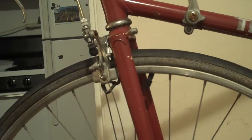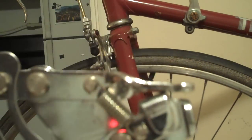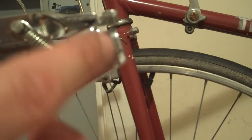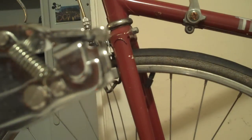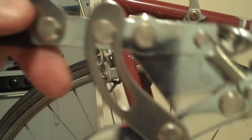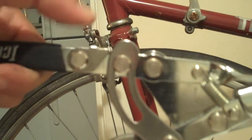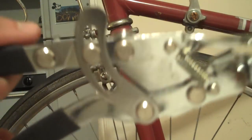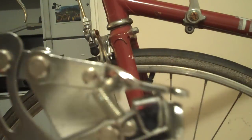Basically what this tool does is hold the brake tight while you're able to tighten that bolt, so it gives you a third hand. So basically what you do is take your cable puller and put the cable right through here. Make sure everything is loose because when you tighten it, it starts to clamp down, so make sure it's loose. And then over here you've got a little thumb lock which you can hear click as it locks, and when you try to open it, it stays. So you pop that open and make sure everything is loose.